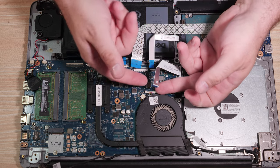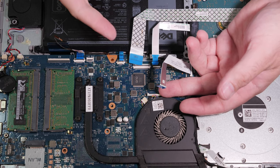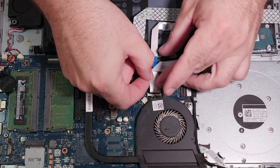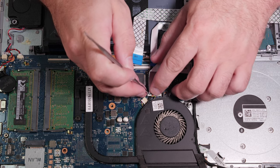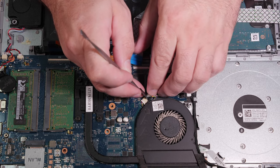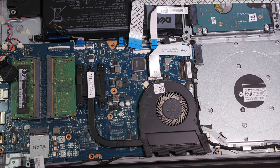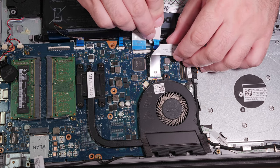The optical drive is the one that goes into this weird connector here. You remember this weird connector from earlier? This little weird connector that is by the CPU fan and it lifts up. It slides down into that groove between the white compression fitting there and the brown base. And you can just push, once you got it down. You kind of have to get one side tight, then get the other side tight. Check it for matching. It matches, we're good. Okay, that's down. I'm gonna do the battery last so I don't run the risk of blowing anything up.